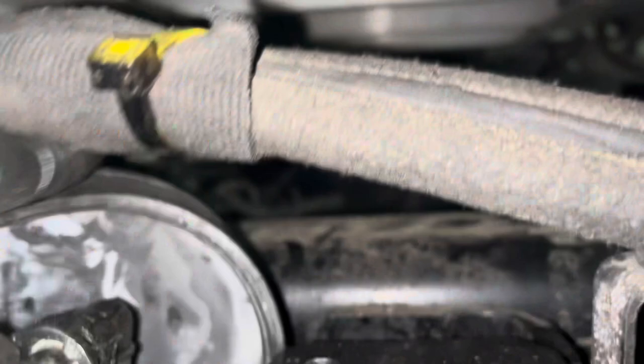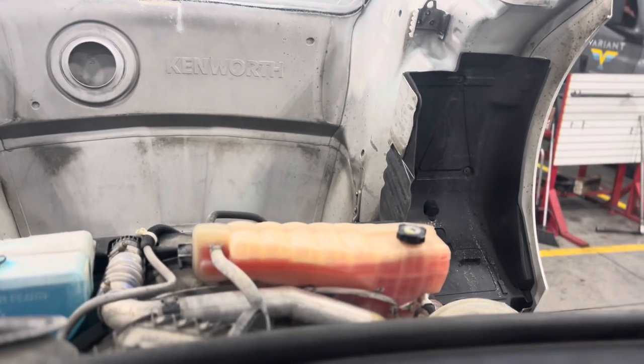Get your sensor down and connect it in there. Take this cover here, put it in there. Now that sits — it's tight, the gasket is in, the bolts are back on. And now I can take this cover and put this cover back on. Didn't lose that much coolant here, but you just want to fill it up all the way towards the cold fill line. And then bleed the air out of the system — it's good to do that. Let it run and let it suck as much coolant down as needed.